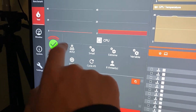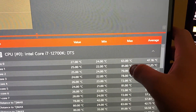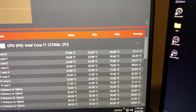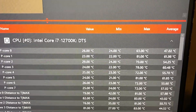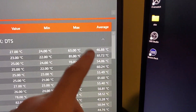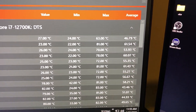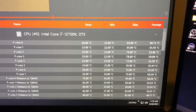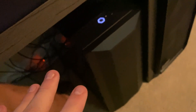So I ran OCCT small AVX2 extreme for about 10 minutes. The max temperatures — the delta was 81 to 63, so about an 18-degree difference. That is actually very significant, especially between cores that are right next to each other. Averages are also pretty all over the place — that's about a 15-degree difference — so there are some weird temperature issues right now that I'm hoping we can fix. We'll go back after and run AVX2 after we do all these mods, but now let's take the PC apart and get to working.